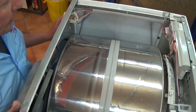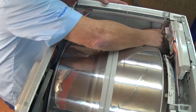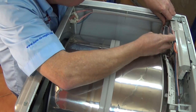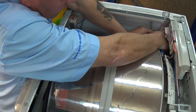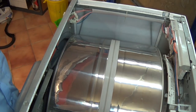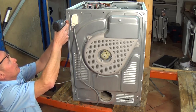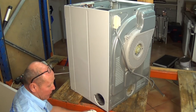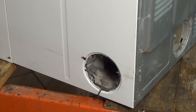There are a load of screws at the back. The motor is situated on the left-hand side of the machine, so this is the panel we want to take off. There's a clip down here and also a nut hidden in there, so we'll remove them first — using a small screwdriver, ease the clip back. Now we'll go to the back of the machine and remove the four screws there. First thing we need to do is remove this vent cover — this is one of the side outlets for the vent tube, and as I always say it's very important that you clear all this fluff out with a vacuum cleaner while you're doing the machine.